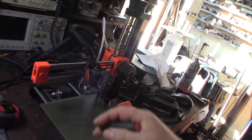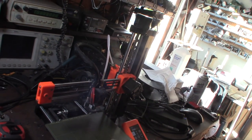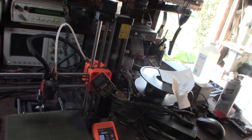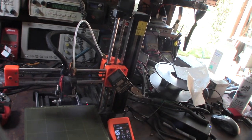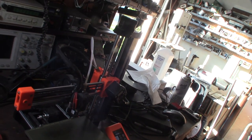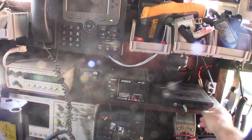They designed this to be simpler so people wouldn't need to know G29, which you normally add manually in the startup G-code in the slicer. I'm going to do a simple calibration cube — take the SD card out, put it in my computer, copy it over.